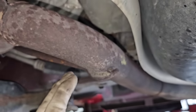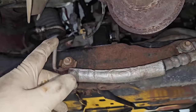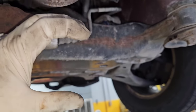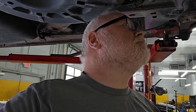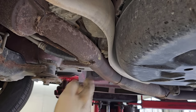So what I'm going to do is Sawzall this right here. The other thing is that flange is clocked in a certain position. The AC drain is dripping over here. That flange is clocked in a certain position, so the problem is I'm going to have to get the flange mounted up on the exhaust, mark it exactly to how it's got to sit, tack weld it to this pipe, do a final weld, put it up in place, weld it, then drop it back down so I can weld the top of it. It's going to be a bit of a procedure. I had welded the exhaust back there before because the slip fit had rotted off at one point.